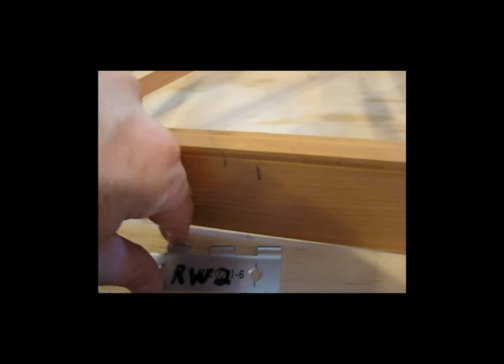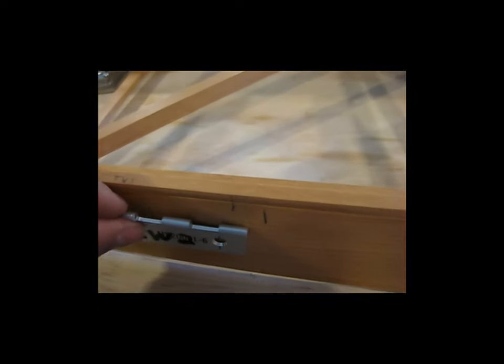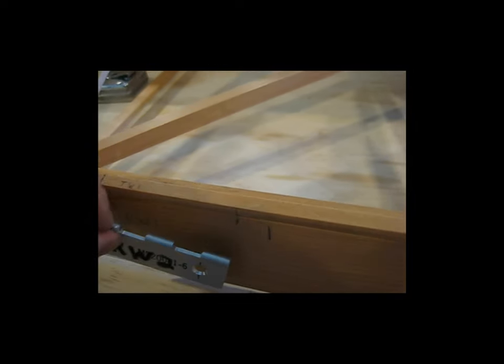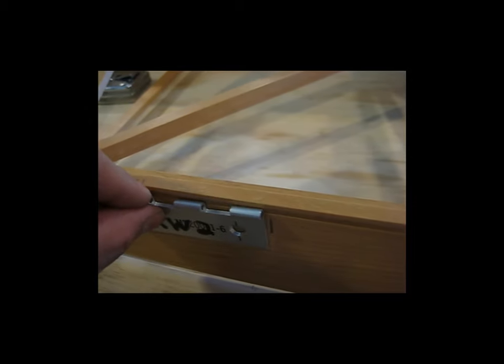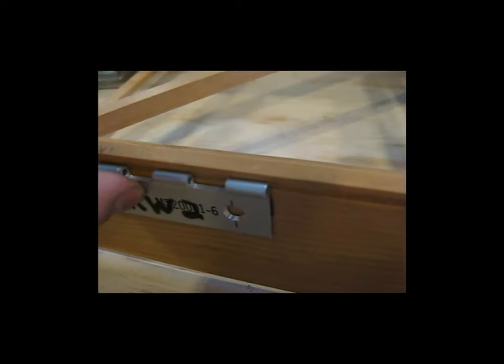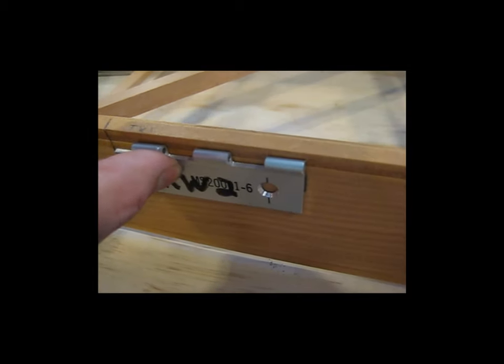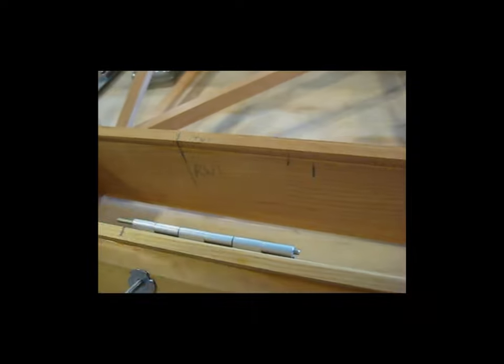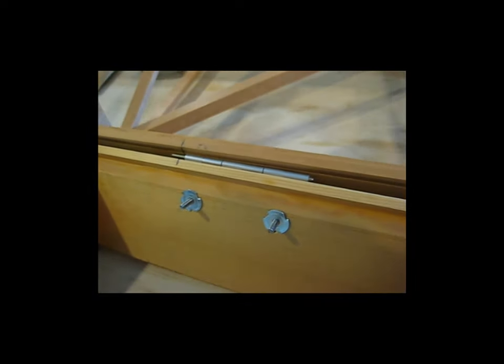Since I've got my hinge reference lines drawn on the wing, all I need to do is grab the wing half of the hinge, put it on my line, and then bring it up so the hole of the knuckle lines up with the line between the filler and the spar. Then I mark my holes, drill, bolt, and hopefully when I fit the aileron everything mates together really nicely. I know it will, because I've done the other aileron on the other wing and it worked out great.